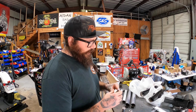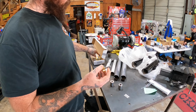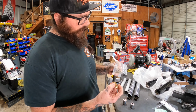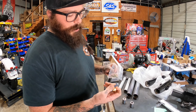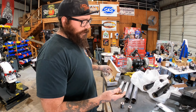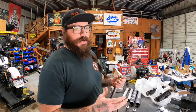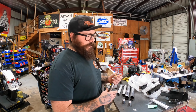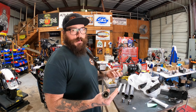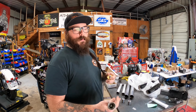And the way we control that is a couple different ways. Spring tension, so there's two different springs. We have typically a light spring and a heavy spring. I forget which one is which, I'd have to look it up. But the two springs and then the spring tension on there, as well as the viscosity of the oil. So depending on what you're trying to accomplish with the front end depends on how you want to adjust it. So if you need your rebound and your compression both to be a little bit slower, then a thicker viscosity oil can accomplish both in one go.